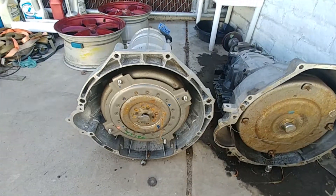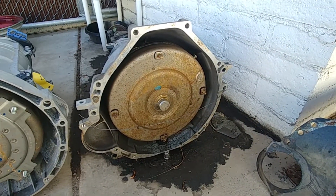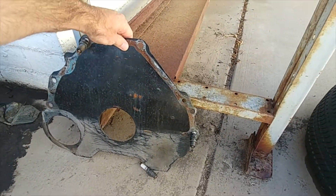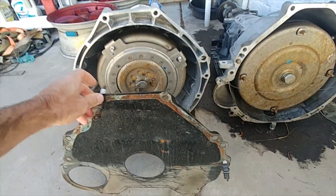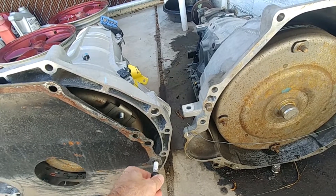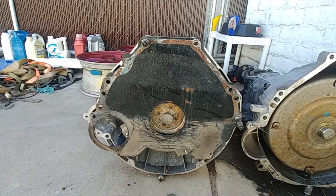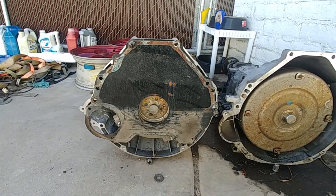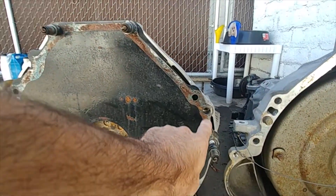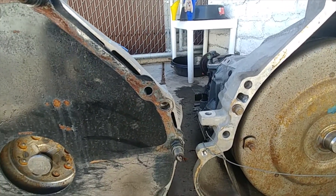What's funny is the spread — the distance from the bolts to the center of the crank — is the same on both small block Ford and a mod motor, and the dowel pins also line up exactly the same. So what I have here is a 60s-era 157-tooth starter spacer plate, and you'll see the top holes line up, the dowel pins line up, and this bell housing bolt here lines up, which is pretty amazing.